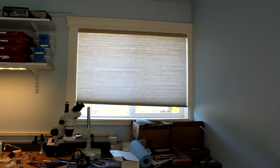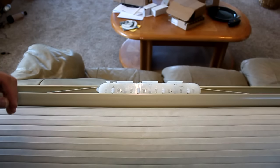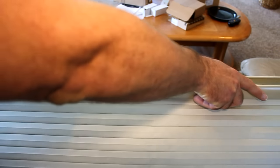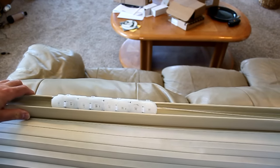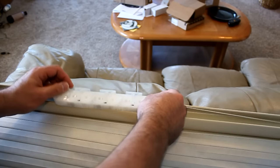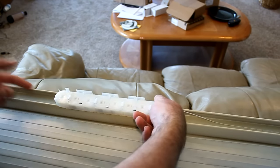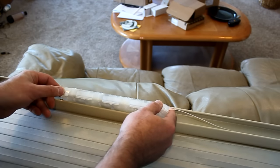Now let's see what we can do to hopefully repair this. I've already done some work tearing it apart. I'll move this down to where it came from — when we open it up, this little cartridge will be in there. It snaps in, kind of wedged in under there. You'll have to take a screwdriver and pry at it, wedge one under here, wedge one under there, and eventually you'll be able to snap out the white cartridge.